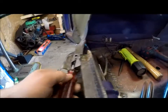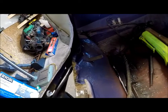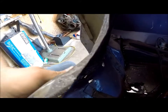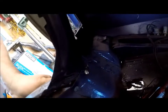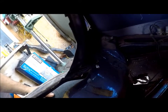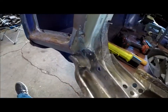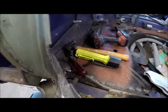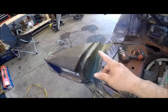I had missed one spot weld there, but just pry it up - you can see it moving already, it comes pretty easily. I don't mind prying against the panel that's coming off because I have a replacement and I'll take my time removing it. This panel is glued in with some kind of seam sealer here, but it came apart pretty easily - took a bigger screwdriver, came in here and hammered and it pretty well separated. So if you take your time it comes right apart. Everything separated - I want to bend the old panel carefully and hopefully keep the stuff I want to tie into straight. I'm going to do this all the way around.